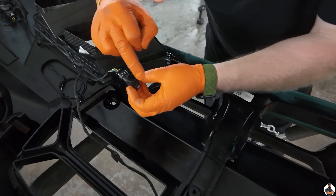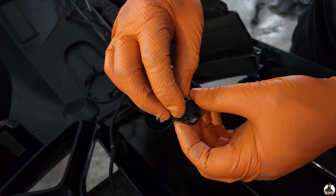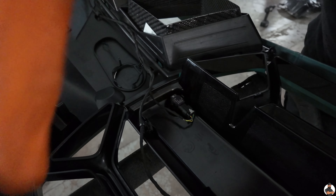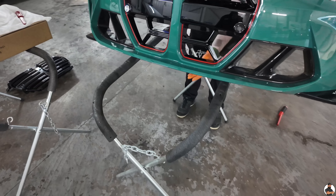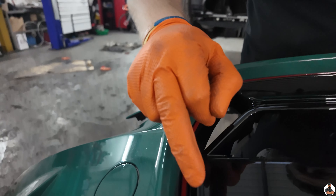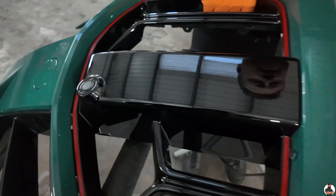The PDC sensors have got a little rubber seal just around them — you can see it just pops off. Ensure that that's fitted correctly. We'll pop it up and have a look to see how the sensors look once they're fitted. Checking that the actual O-ring's not trapped and that they're fitted correctly. We're all good.